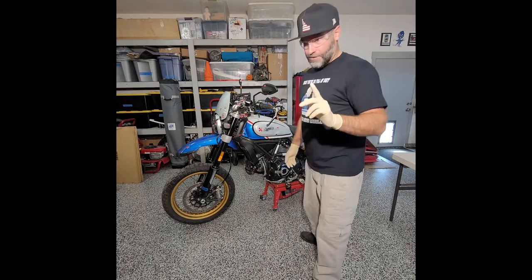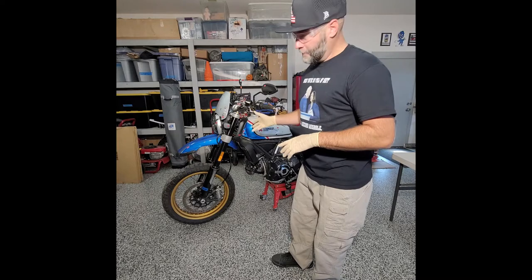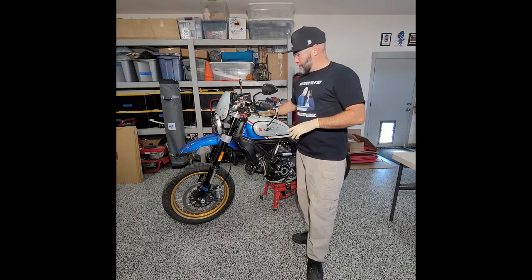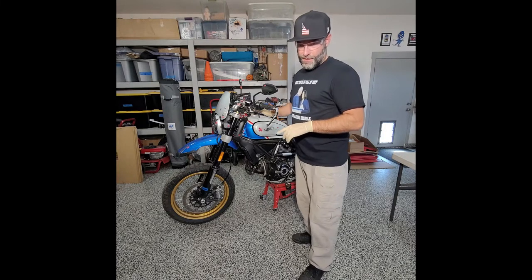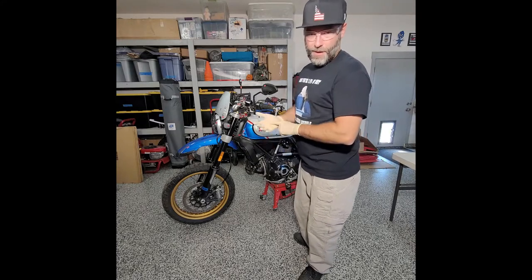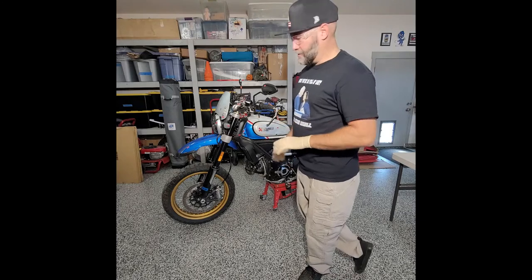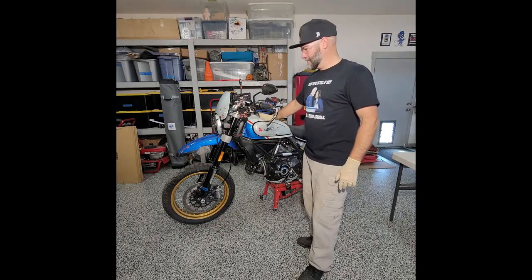And big thing, if you do this, especially when you're doing brake fluid, make sure that you wipe the body up when you're done. You could cover it first with a blanket or sheet, something to absorb that stuff, and then I would still wipe it down afterwards with some brake clean sprayed on a rag. I use some window cleaner with a microfiber towel at the end, just to make sure it's really clean and I don't scratch the paint, even the undamaged paint sections of it.